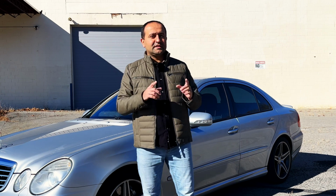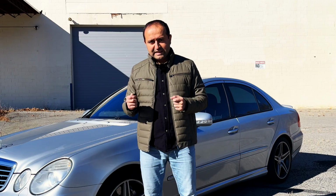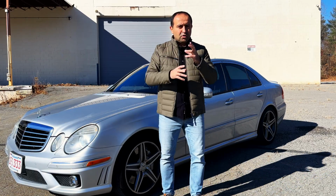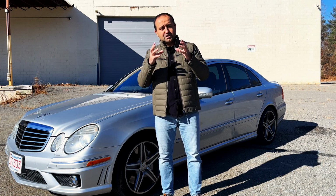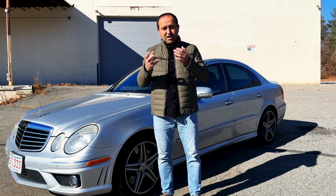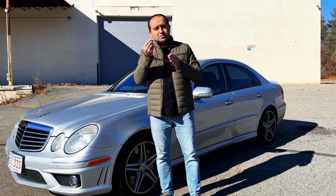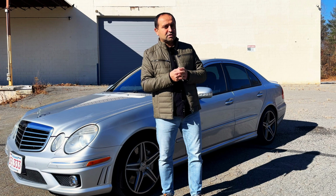With that aside, tip number 2 is to keep your suspension elements clean. I like hosing it off because all the salt and dirt not only shorten the life of the rubber in the air springs, making it hard like plastic, but if there are micro cracks, those dust particles, as I talked about earlier, will get into the system.